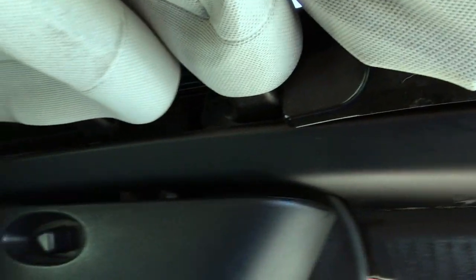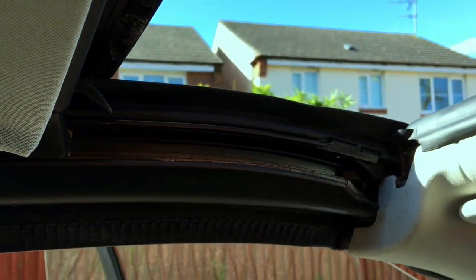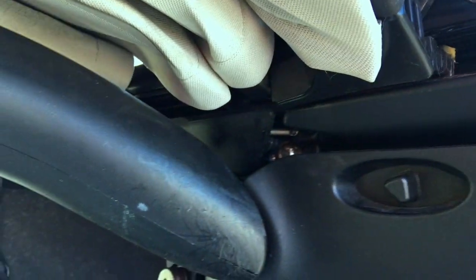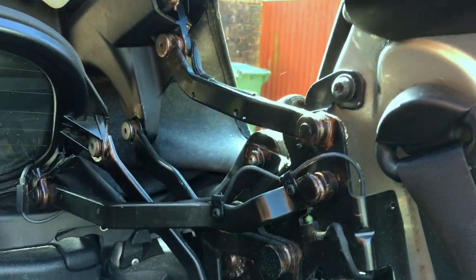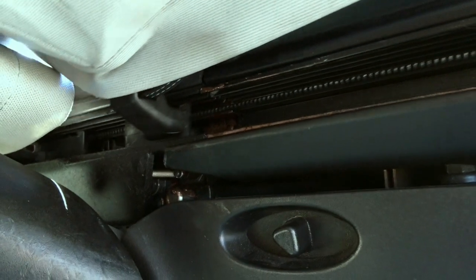Then go behind it with a cloth. Just check the action as you're going across — I could actually noticeably tell the difference, not necessarily how much more quickly it was, but how much more smooth it was. I felt there was less strain on the motors — I could hear the motors purposefully working less hard. Just do this a couple of times, working the grease into the lowering and raising mechanism, not just on the hinges but on the guide rails and the guides themselves attached to the fabric roof, just to make sure all the gears and metal parts are covered.